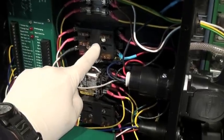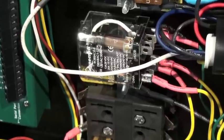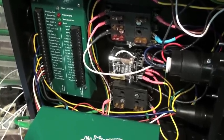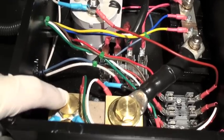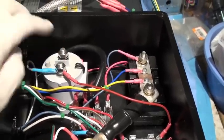I've got a fuse box here that will be for my 12-volt power — I believe this one is key-on and this is always-on on the bottom. This is the AC detection relay so that if it's plugged in and it detects 120 volts through one line, it will set off the relay and turn the Zilla off so the controller cannot be turned on. This is the DC to DC converter, hooked in so that it's getting its negative supply from this end of the amp meter and its positive will come off of the positive lead coming to right here.